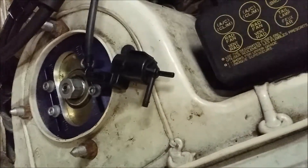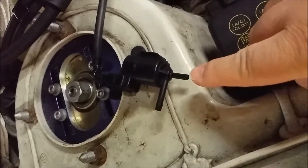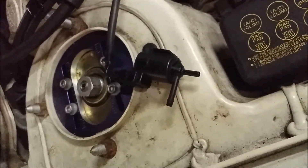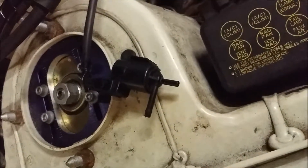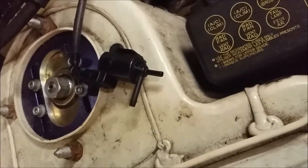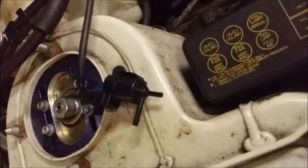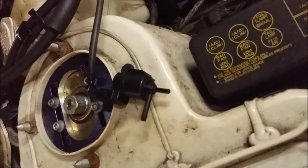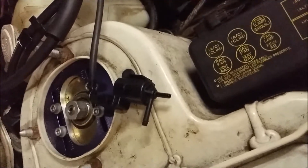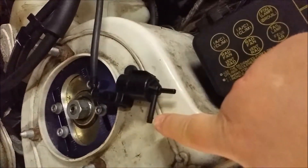This is the high pressure side. If you feed this side with high pressure, it's going to bleed at roughly about 20 psi and it won't stop bleeding since the passage is open. It's like a ball and spring type manual boost controller — if you open it, it will bleed until you fall below that pressure. So feed this line with pressure.